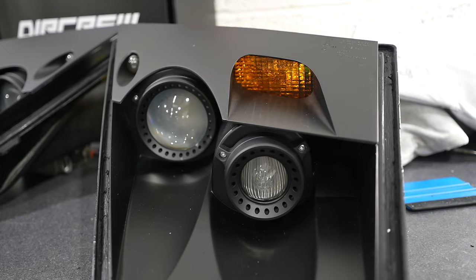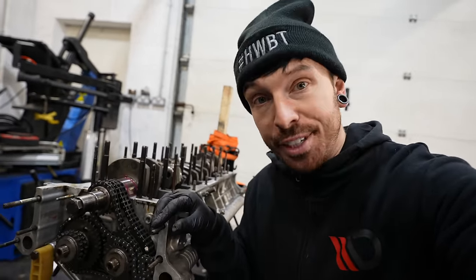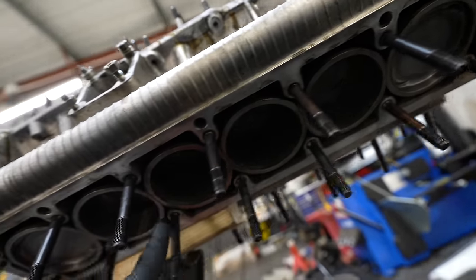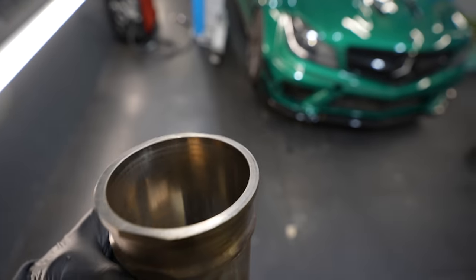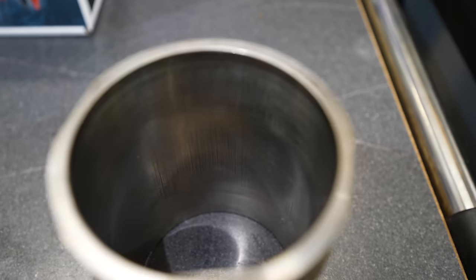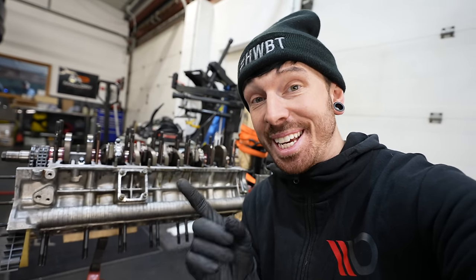But I bet you're wondering why we had to take the engine apart again. We're still waiting for the 3,000-pound oil pump, which won't arrive until the 12th of December. But we noticed something that made us take this engine apart again. One of the cylinder sleeves — each one is 499 pounds plus VAT, and there are 12 cylinders — had some scratches and scores along the inside. Scratches or scores in a cylinder can leave gaps for oil to get into the combustion chamber. We probably should have changed it last time, but we didn't think it was too bad. The more we looked, the more we knew we had to do it. So a new cylinder sleeve is now in the engine.